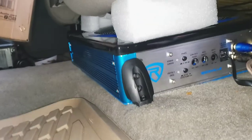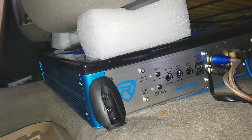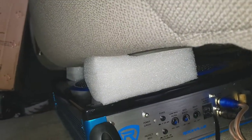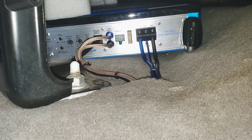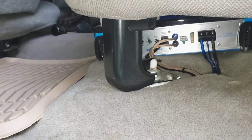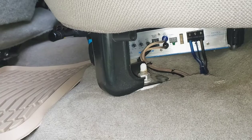Here's where I decided to mount the amp — you can see it's neatly placed in. You might be wondering what these foam pieces are — those were the foams that held the sub in the box. I trimmed them down and I'm using them to push down on the sub and wedge it between the seat, since there aren't a lot of places to mount it. It is screwed to the carpet but the foam helps wedge it in. You can't see it from the top — you can only see it if you actually peek. So that's the finished installation — hopefully you guys like it. Feel free to leave a comment if you have any questions.